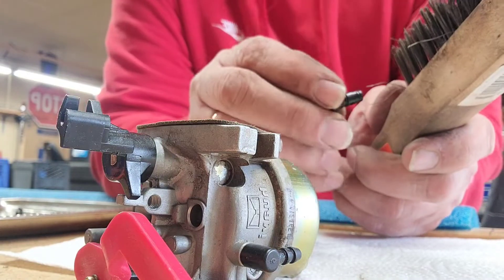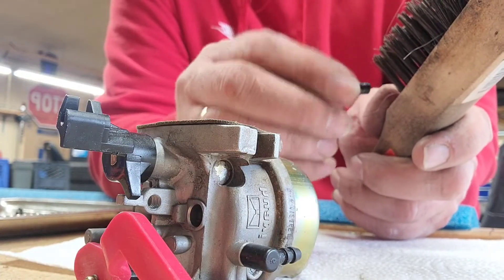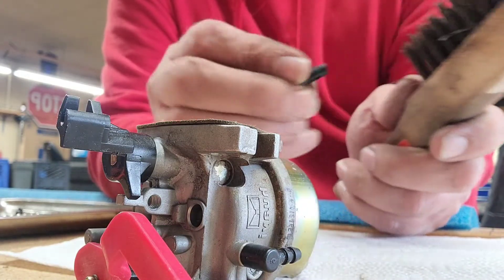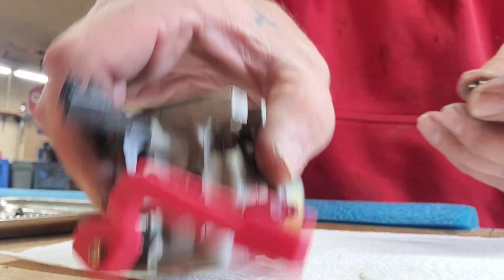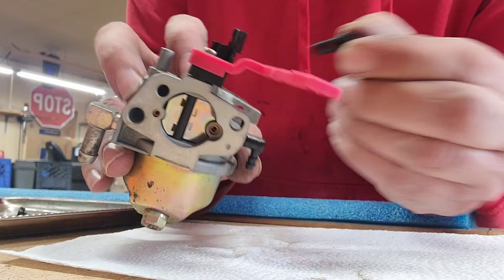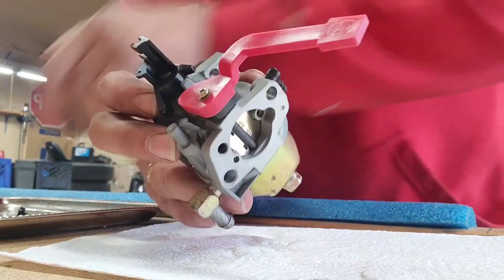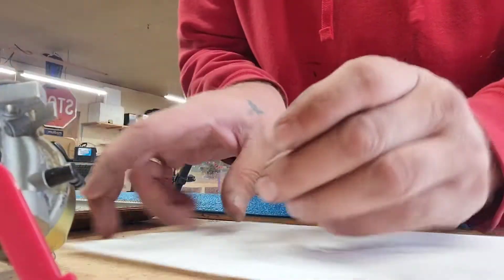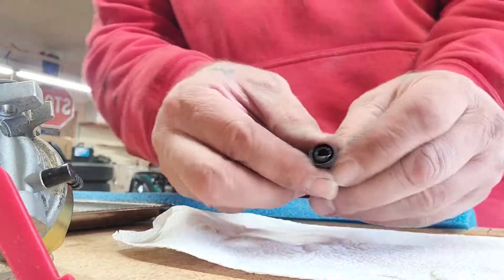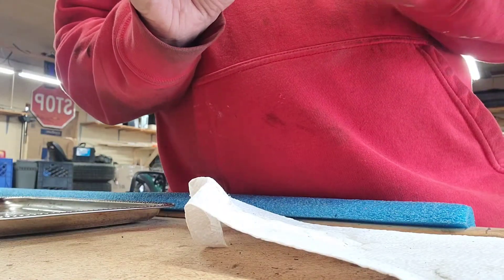A good practice is if you can see inside that larger hole on the side — these are very fine jets — kind of work it back and forth a little bit. There you are. Put it back inside — make sure it seats, it's got that little groove on it. Make sure it seats all the way down before you put that other screw piece on. A lot of manufacturers don't want you messing with stuff, which is why they put that special head on that little plastic screw.